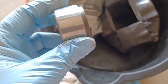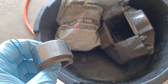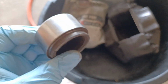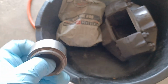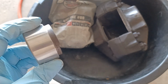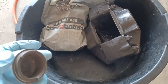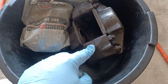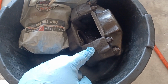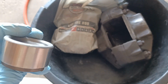Okay, just a tip. I'm sure there are other YouTubers that have put that out there, but I just wanted to make sure people understood not to go to town on these pistons, or you're pretty much going to be throwing them out and ordering new pistons. Part of the reason I was rebuilding these calipers is a rebuild kit for this car is about $7, while the ATE calipers, remanufactured or new, are about $450. So it's much more cost effective to rebuild the calipers.